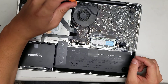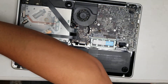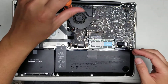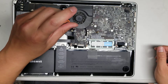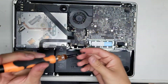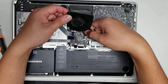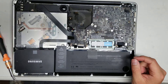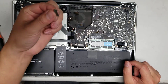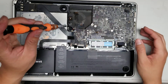Then you've got the fan. I thought this needed a T5 bit, but on this model they actually use a T6 — I'm not sure why. A lot of times it'll be a T5, but maybe something changed or someone worked on this before. There are three screws holding in the fan — just take those out and then lift the fan out. Get as close as you can to the connector and pull it up. Make sure you don't pull these connectors out of the board — I've seen people rip them out. There's a bunch of dust here, so I'm going to clean it out. I usually take it outside and use a toothbrush — I don't want all that dust in my work area.